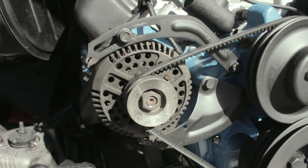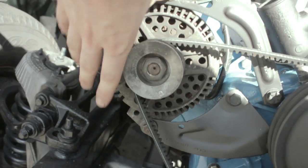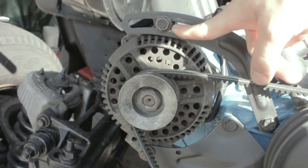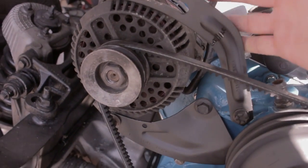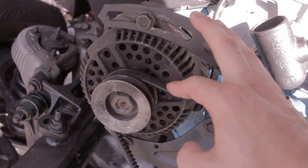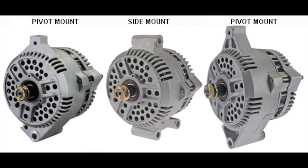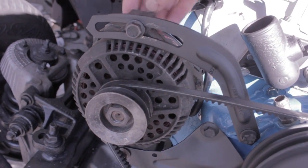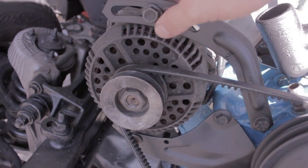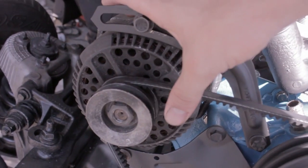Once we identified that I did indeed grab the right one, the only thing you have to worry about is the ear spacing. Right here to here, it's going to have the same spacing as your original 1G alternator. If you're a fifth or sixth gen guy — like this truck, which is a sixth generation F100 — what you're looking for is an eight and a quarter inch ear spacing with pivot mount. Some people will tap threads through the ears for the bolts because this is smooth, but we just grab a nut and a lock washer since it needs to be adjusted for belt tension anyway.